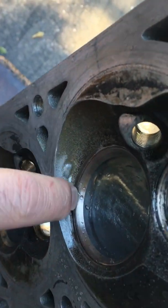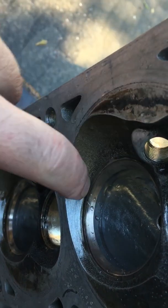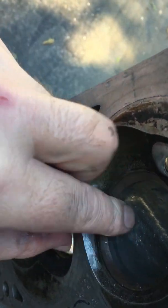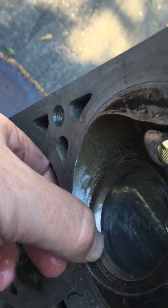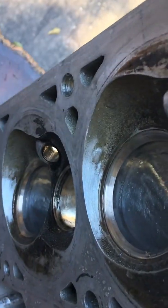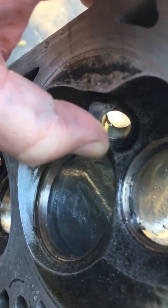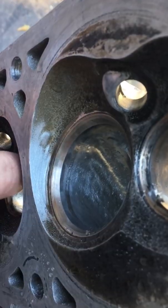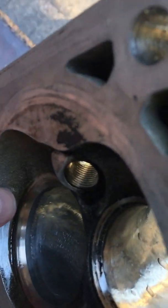There's also a section through here on the head where you can see they ground them out slightly — maybe to get the seat in, or to open up a little bit of flow. I just took them down slightly, didn't take a lot out of the combustion chamber at all, and just rounded off this edge here for the spark plug. Tried not to take too much out; all I really wanted to do was smooth it and maybe give it a slightly better path for the air to flow around the valve.